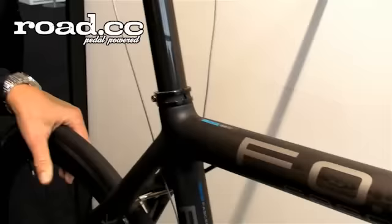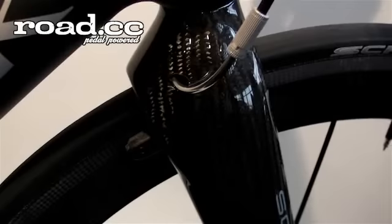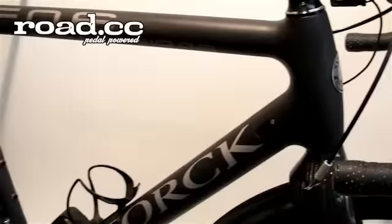What's the thinking behind integrating the brakes on this bike? The key point is everybody's trying to reduce the weight on the frame, and I feel it doesn't make sense to use a higher grade carbon fiber and to make it thinner and thinner — then the frame gets a much more brittle ride, plus the material is quite difficult to make a long lifespan of it when you hit an obstacle or anything. So I feel it's a better way to integrate systems like brakes into the frame and get some weight saving out from that, instead of making the tubes thinner and thinner.